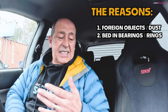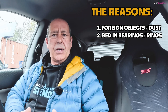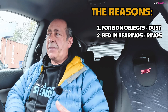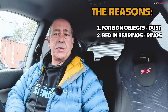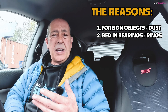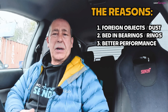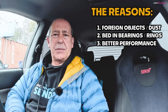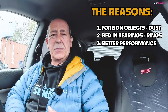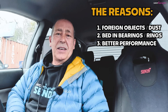The third thing is it helps identify any issues — any leaks, anything not quite working perfectly. By taking it easy for the first number of miles, you can identify these issues before they've cost you an engine. The next thing is it helps the performance: if you've broken it in gradually, it helps all the components work together without stressing or heat-damaging something early, so it will help the long-term performance and longevity of the engine. As boring as those miles are, it is worth it in the long run.